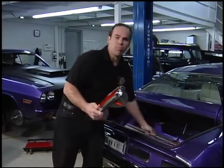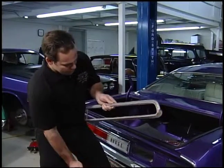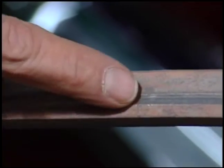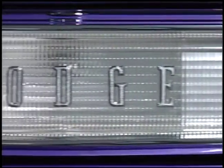The only really tricky part is the tail light frames. These aren't reproduced by anybody and you can't get them brand new anymore — they're impossible to find. We sent the original one in and you can see the plater stripped off the old chrome plating, but he had problems with it starting to pit. You can see all the pits in there and that isn't repairable — this is pot metal. He tried grinding it and the pits still didn't come out. So we went to a California car that wasn't pitted, got that piece, sent it to the plater, and it's perfect.